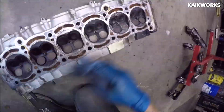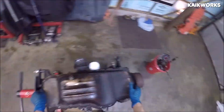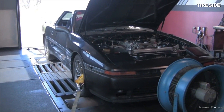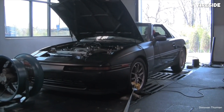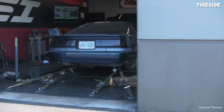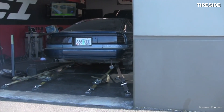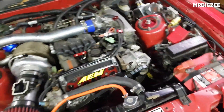The simplest fix for this issue is to re-torque the head bolts to the proper spec, and a common upgrade would be ARP head studs rather than head bolts. Another common problem is rod knock, and unfortunately this is because the 7M GTE isn't built to the extremely high standards of the 1JZ and 2JZ — it's simply not as strong or reliable as those later engines. That said, it's still a Toyota engine capable of outlasting most other road car engines. The 7M GTE was one of the least reliable Toyota engines of the 80s and 90s, but that still makes it a very reliable engine overall.